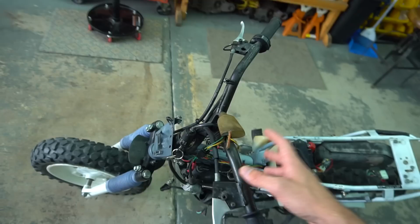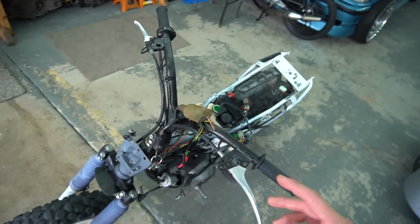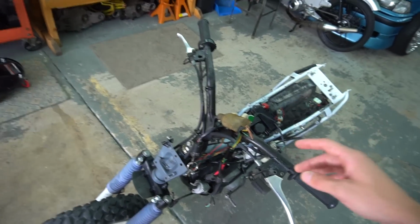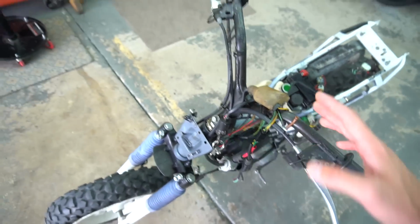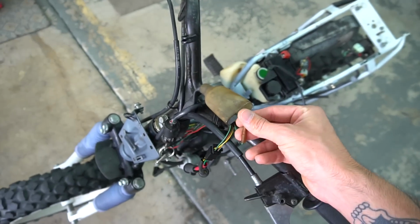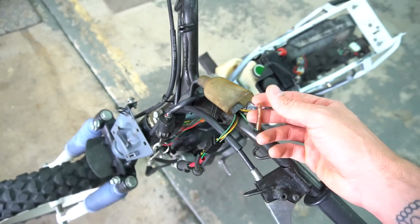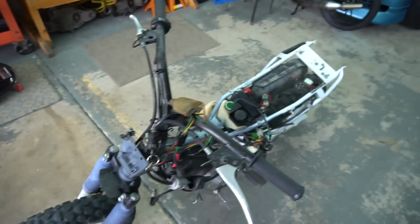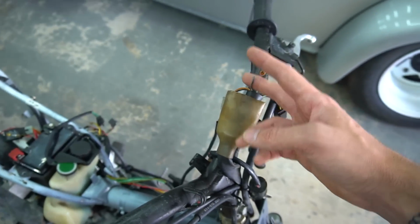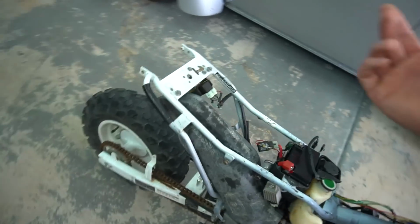Well, it turns out the connection on the kill switch itself on these is an open loop power. So you don't want a connection, you don't want the 2 touching in order for the bike to run. So basically, the last owner had it backwards. He had it plugged in and looped, which is basically keeping the bike on off the whole time, aka giving the bike no spark. I disconnected that, clipped it, and what do you know? With the new CDI box, the bike has spark.